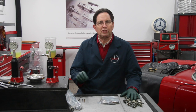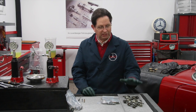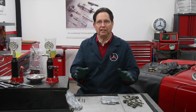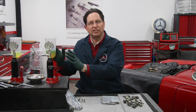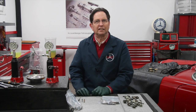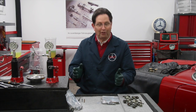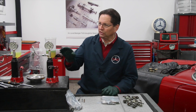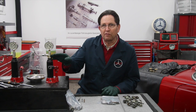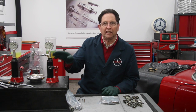We've even come up with some special tools to clean the valve and the seat. I was not successful with every one, so there's no guarantee. There's no guarantee you're going to be able to use my tester and my tools to clean internally into the injector and have it work. But at least you're going to find out whether or not you have good or bad injectors. I want to show you this one we just finished up for the 280 SL — I want to show you how well this one is working.